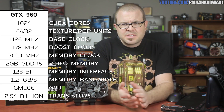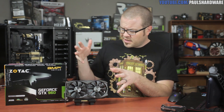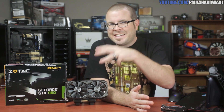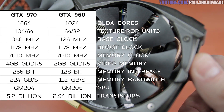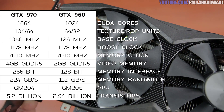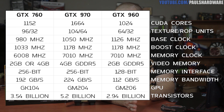When I first saw the specs of the 960, I was actually a little bit confused — I was surprised to see the memory configuration. I've had an internal argument with myself, coming at the GTX 960 from three different perspectives. The first perspective is NVIDIA's. They made the 960 after all, and I think their goal is to jam as much performance as they can into a $200 video card without cannibalizing sales of their other cards like the GTX 970. So you have 1024 CUDA cores, with the GPU base clock juiced to 1126 and the boost to 1178. But they also did some things to slow down the card's performance — there are 32 ROP units, which is half of what the 970 has, and only 2GB of memory on a 128-bit bus. The GTX 760 also had 2GB of memory by default, but it was on a 256-bit bus, which just kind of feels like a step backwards.